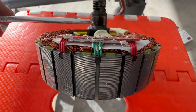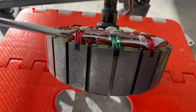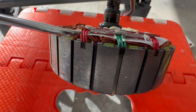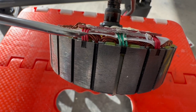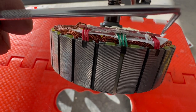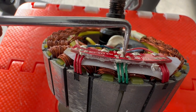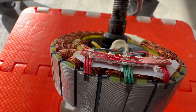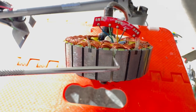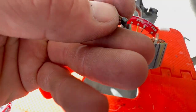Clean the silicone which is holding the PCB here, and after that with a small cutter cut as close as you can to the PCB, so we can reuse these shrinks on the other sensors. And you have to clean the solder and open the holes so the new sensor passes through. Very easy. The middle sensor is very easy to take out with something sharp. You just get it from below and pull it out. This is the middle one.